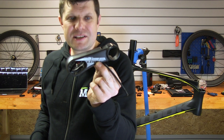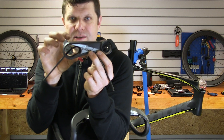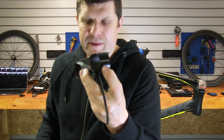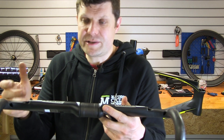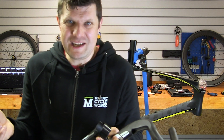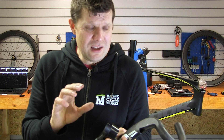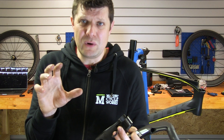One more piece of crazy engineering: the monoblock stem. This is going to be height-adjustable with a cool aluminium section that fits in here, and you can actually adjust the angle of the stem. The handlebars clamp around this design to make a beautiful clean aero look at the front of the bars. All the cables run through here — they're actually fitting SRAM AXS on this, so the only cable we'll see is the rear brake cable, and even that gets threaded through this aero block stem. Every single part of this bike has massively over-engineered, completely bonkers attention-to-detail — it's like putting together a Formula One car.